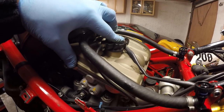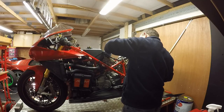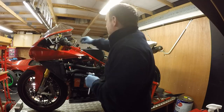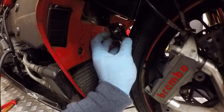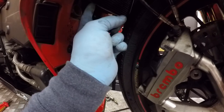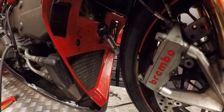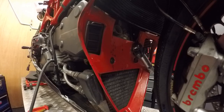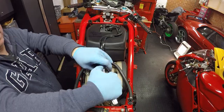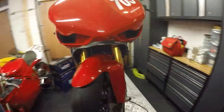So let's get these stick coils out — the vertical one is nice and easy, just a little allen key there, and then we'll pop that out. I had to loosen the radiator off because this little fin on top of the coil just catches on the lip of the radiator. Both spark plugs are now out so we should have no compression in the cylinders when we turn the engine over.